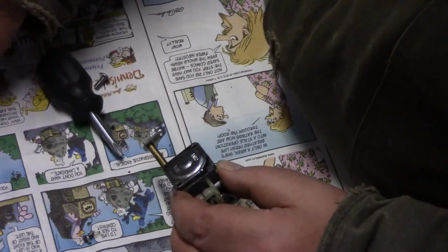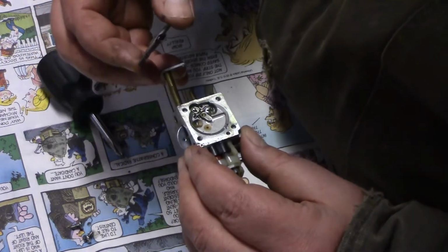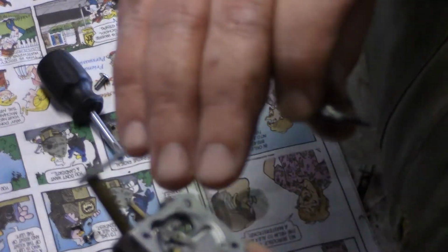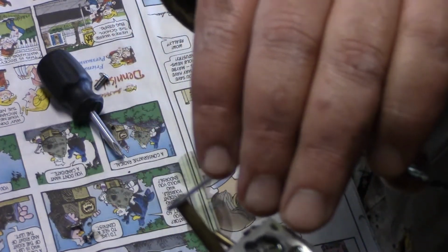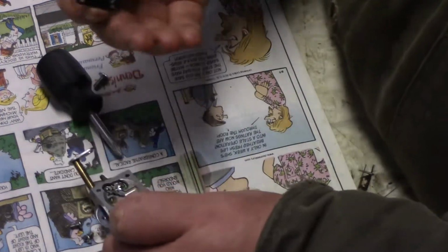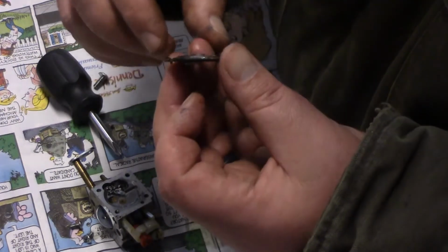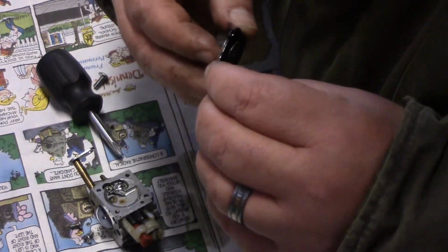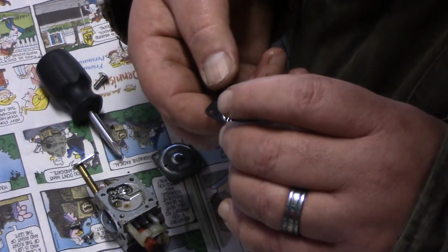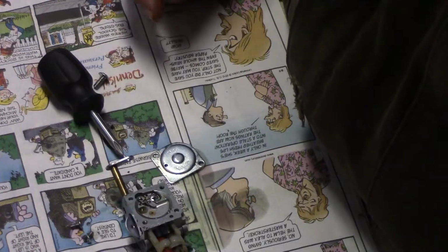So of course we have that really wicked good gas with ethanol in it. So the ethanol gets right inside there and gums everything up. That's not too bad. You can see inside there, it's yellow. The gas is sort of thick, so the ethanol has congealed a little bit inside there. And if we can get this off, I just want to see how pliable this is. Well, it's pretty pliable, so that should still work. So I have that off.